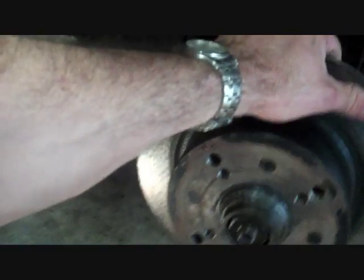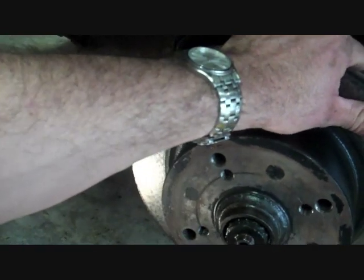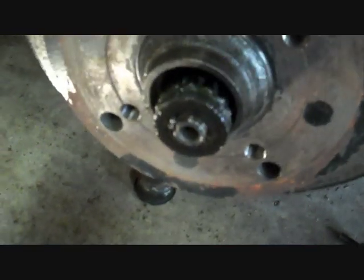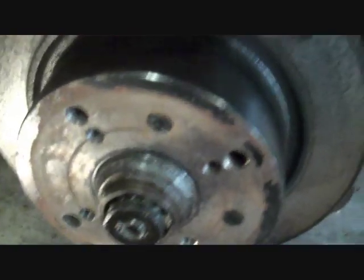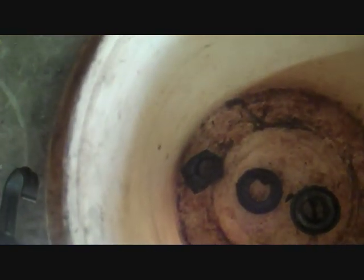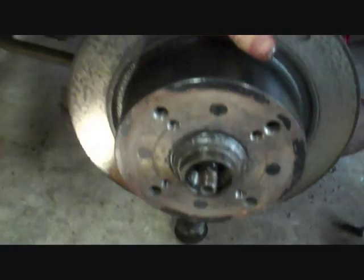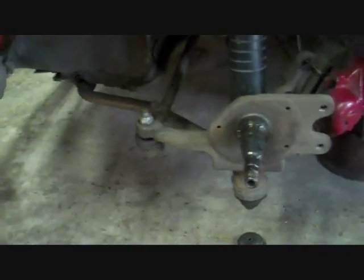And the front wheel bearing will just pop straight out like that. So there it is, in amongst all that dirty old grease. Okay, so there's the locking clamp nut, the washer behind it, and the first outer bearing down there, the smaller one of the two. So now with those off, the whole disc will just simply lift off.